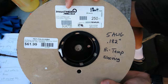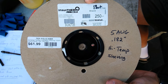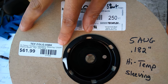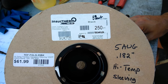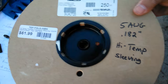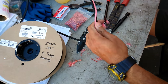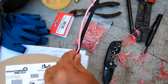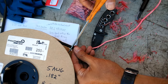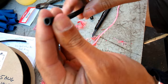Now I'm going to use some black InsulTherm — it's called TrueFit. It's high-temp flexible fiberglass sleeving rated for 1,200 degrees, which is going to be plenty for this. I could even use it in an oven where wires are exposed to higher temperatures, but on a stove you're not going to see 1,200 degrees. I match up a piece as long as the wire I'm putting it on, cut it off with scissors, and you can see the wire is just going to go through the middle of that.